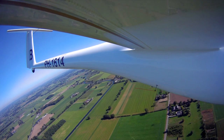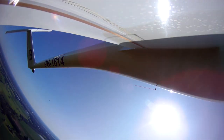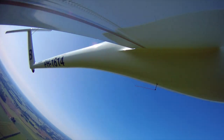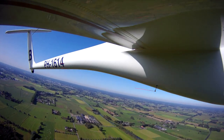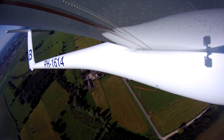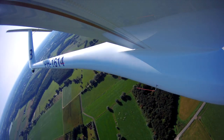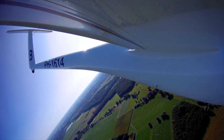As I did the testing at the end of the season, I only had a few short flights to test, but the jumping of my altimeter seems to be gone with this antenna. Also, the wind calculation by my computer was never very accurate. Since the static pressure is also used for the indicated airspeed, it is interesting to see if the wind calculation has improved as well. I will have to wait for the next season for this.